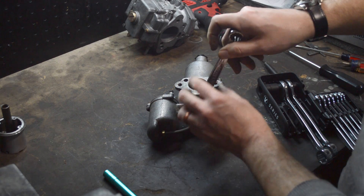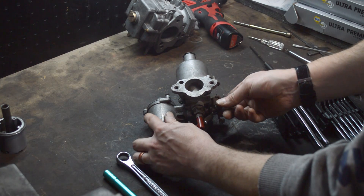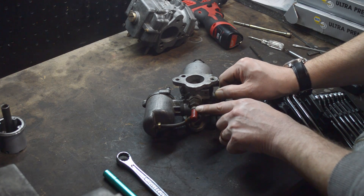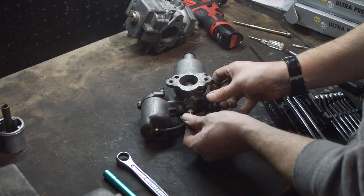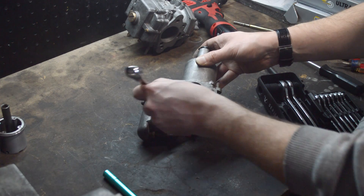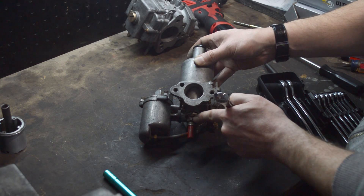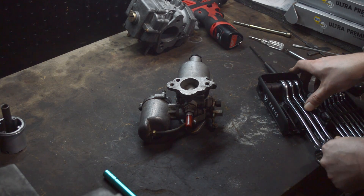This is threaded in — this is the jet here. When you pull on the choke there's a cable that attaches to this and you are moving the jet down, making the mixture richer, because as the jet travels down the needle you've got the thinner part of the needle in the jet. It's also got a spring to keep pressure on it, and by adjusting the threads here you are raising and lowering where the jet is at its stock position. This is how you're going to change mixture on the earlier Strombergs and on most SUs — by moving this one thread at a time. There is a spec in the shop manual for the correct neutral position.